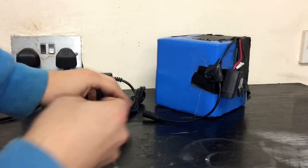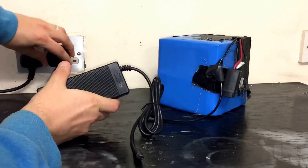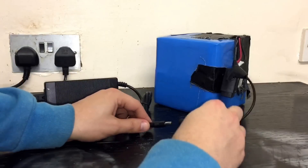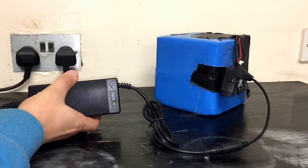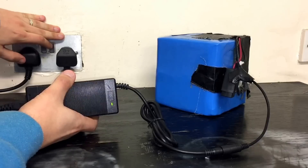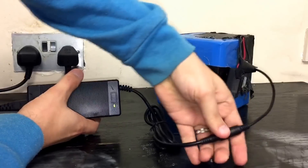The other day it finally gave up on me. Basically, I plug it in and charge it like I normally would, but I charged it up, got on the bike to ride, and it wouldn't go anywhere. Let's plug it in and turn it on to charge — the light should go red to charge, but now the light doesn't go red anymore, it only goes green. Turning it on and off doesn't make any difference.